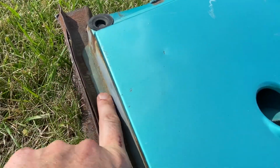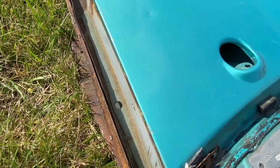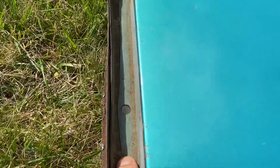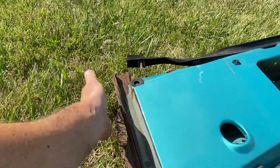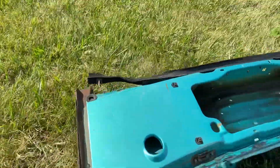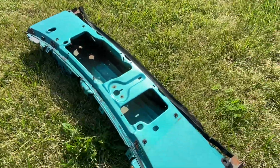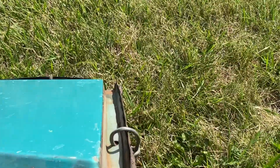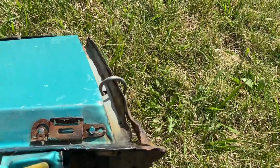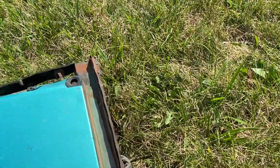This is what you're going to be replacing, this strip right here. So I was far enough away that I didn't discolor or melt any of that. Actually, you can see, hopefully, spot welds, looks like only maybe 3 or 4 along this strip. But that's how I first was cutting them out. And then I learned how to do a Sawzall, and I could be a little more delicate and maneuverable with it. So that just says I took this out a long time ago, but was still very conscious, let me get this in the sunlight, of the required metal to put it back together. So once again, hopefully you all can see, I didn't melt the cowl panel. I just cut through some of this apron material.